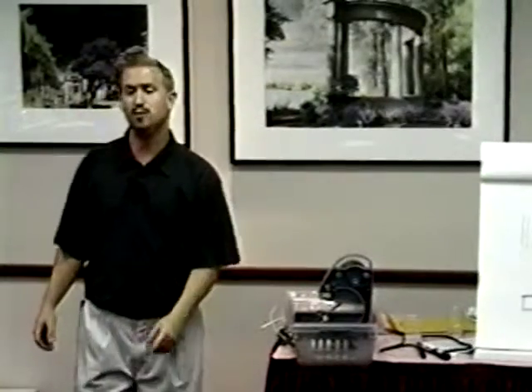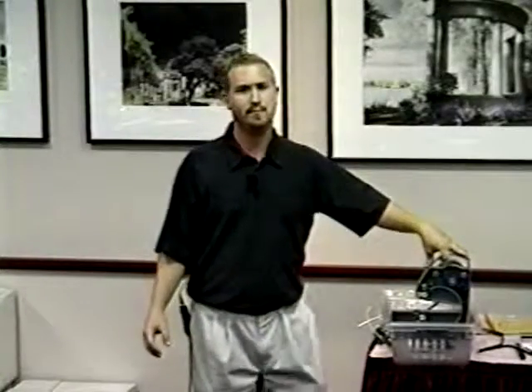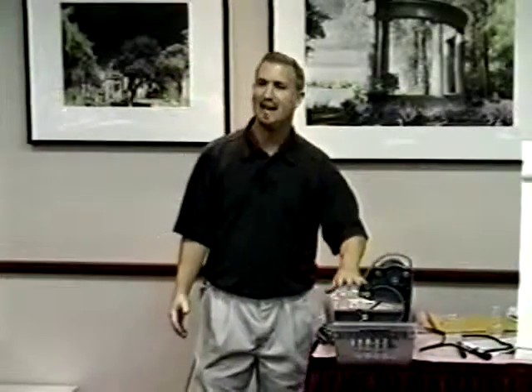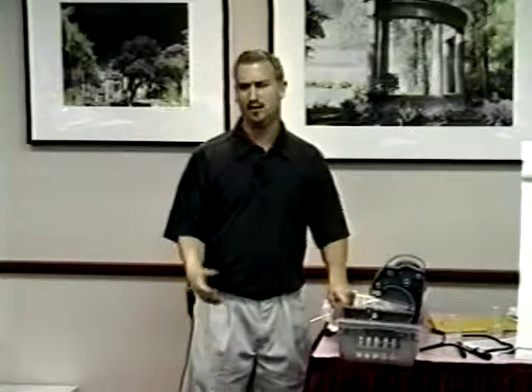The Taurus II was a good saw — the vast majority are still in the market and work great. But when they did have problems, they had loose tension issues. Because it was a hand-poured polyurethane plastic, you'd get component A and component B mixed — and depending on the weather or the person doing it, there could be more or less hardener. So you'd get one with a little too little hardener: it runs fine, then it gets hot outside, and this thing sags down like ice cream. You don't even see it until you start having trouble with the saw.